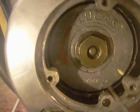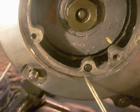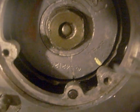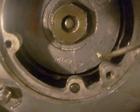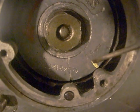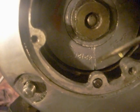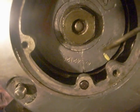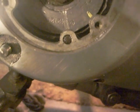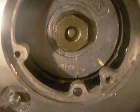If you look here, that's my top dead center pointer. And if you look where the 38-degree mark lines up, it lines up with that next screw there. So all you have to do is put a mark just opposite that screw - that's your 38 degrees before top dead center. That's your top dead center - the line on the pointer. I think a lot of people are setting the timing there when it should be here at 38 degrees. Just put a little scratch on the alternator and you can make a paint mark.